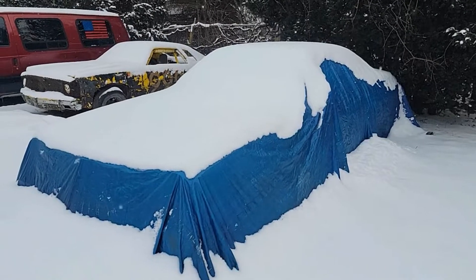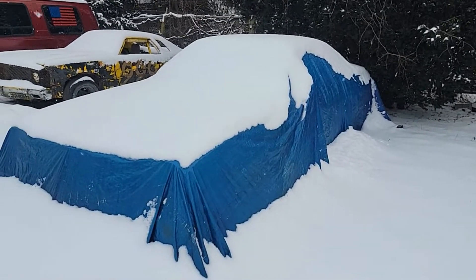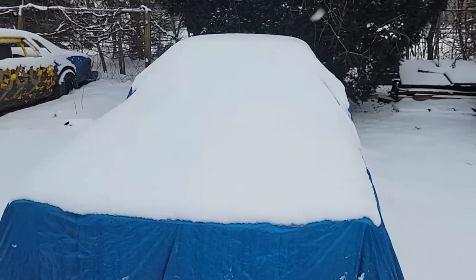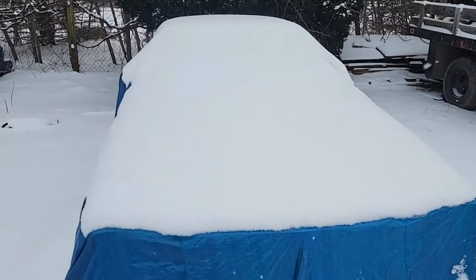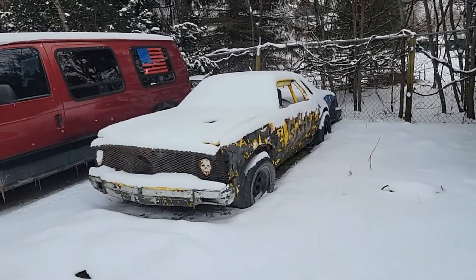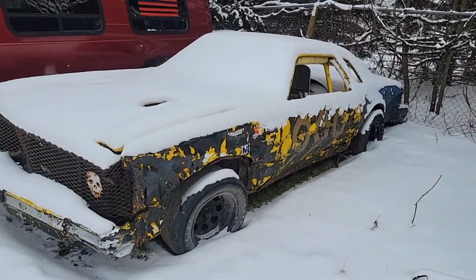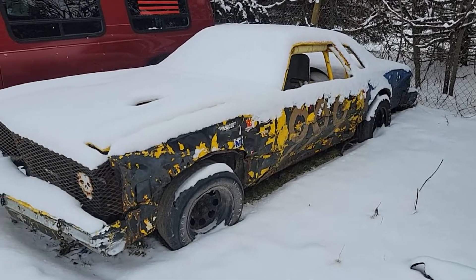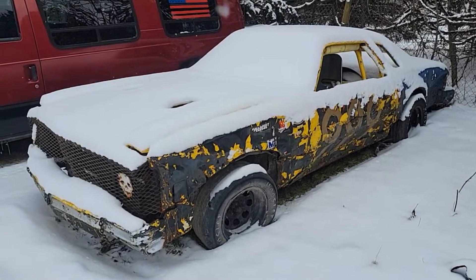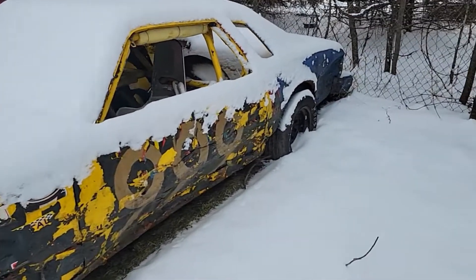We got my 74 Chevelle, all covered up and snug as a bug for winter. The motor and trans need to come out of this — the motor needs valve seals, and it's got a busted-up flex plate and a screwed-up starter. So I'm just going to pull it all out and go through it. I've got the circle track car waiting its turn — it's a priority for sure. We've got to build a really nice motor and transmission for it. I really want to race this at least once this year.